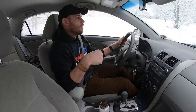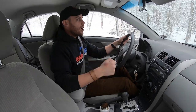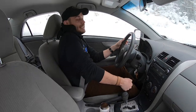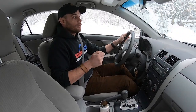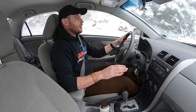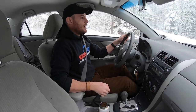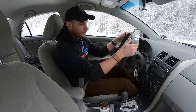That's the purpose of this video and where the emergency brake comes in, because the emergency brake in this car is cable actuated and goes to the rear brakes. The whole name of the game here is not to completely yank the heck out of the handbrake — you're just going to drag a little bit more rear brake than you would normally have. Here at 45 miles an hour on the snow, hit the brakes hard, ABS, not much is happening. Feather in a little handbrake and it's kind of like you drop the anchor — the vehicle stops much more quickly.